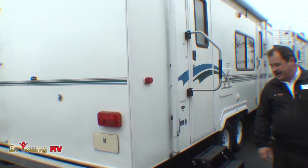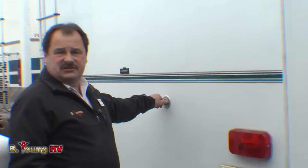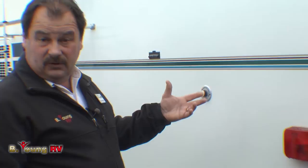At the back it is a rear living area, so it gives you the entrance either in the rear or in the front. If you come around to the back, you'll notice this is where the outside shower is for clean up. The dump station is right here, so it makes it real easy and handy to get to. The black tank flush is right here at the back — it keeps your sensors clean inside the tank so you won't get a false reading that the black tank is full. It'll keep the tissue washed off the sensors and give you an accurate true reading.